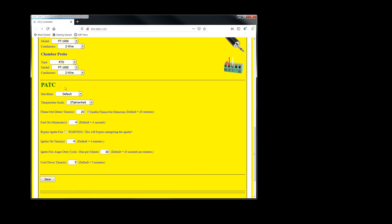The PATSY is a predictive analytics temperature control system — this is not a PID system, it's a different kind of control. These are basically the settings for it, and I recommend leaving it on default unless you have an insulated grill, in which case you can slow it down a little — think of this like a gas pedal setting. You can also set Fahrenheit or Celsius, and here's your flame out detection which you can enable or disable.